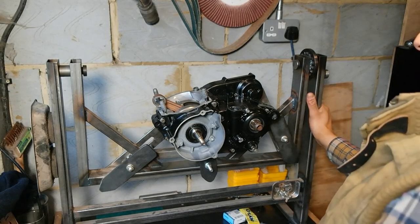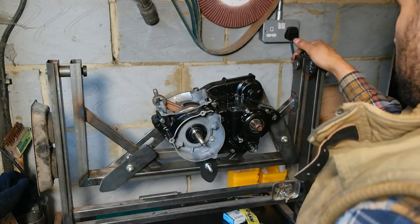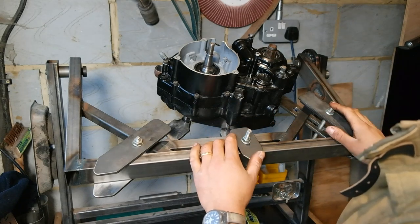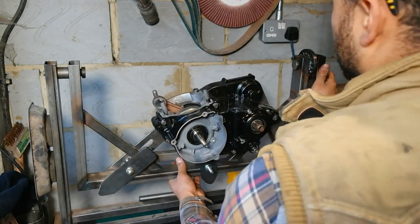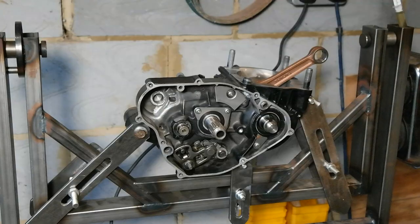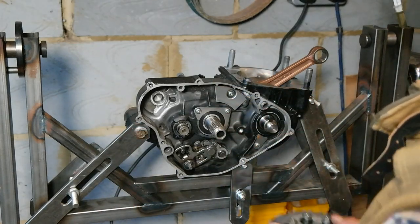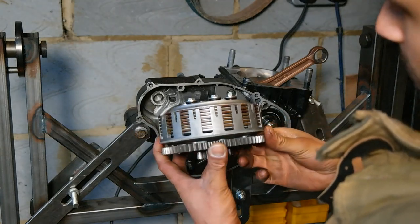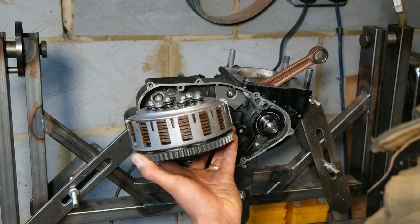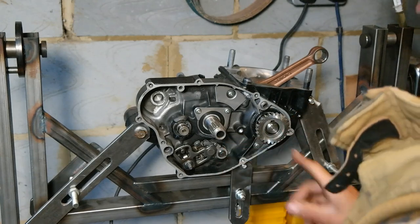The bottom end is pretty much together now - all my bearings and seals are in place. I'm ready to start putting on things like the clutch assembly, cylinder, piston and cylinder, etc. But before that, I just want to transfer this engine - you can see it's mounted on the bolts for the clutch cover. I'm going to change the way it's held in the engine stand slightly to make it more rigid and to allow me to bolt on things like the clutch cover. Now that the engine's mounted to the proper mounts in the engine stand, I'm ready to start reassembling everything on this side including the clutch. Luckily the clutch that was on this bike is in very good condition - the basket doesn't seem to have any notches, the plates look fairly new. I'm going to dismantle it, pop it in the ultrasonic cleaner, clean everything down and use it again. While that's happening, I'll pop this crankshaft gear on and a few other little bits.